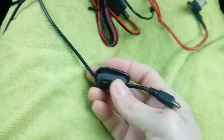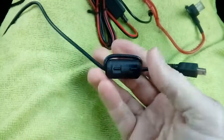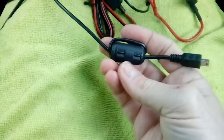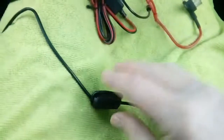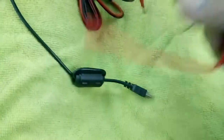Some cars — in particular Mercedes — even with the filter on, they're very susceptible to DAB interference. So if you put a camera in your car and you're suddenly getting DAB interference, generally that's why. It's a very tricky thing to cure. But anyway, onto this particular car — for the Infiniti we will be using the mini blade one, which is this particular one. You don't need the larger one, so you can pop that out of the way.